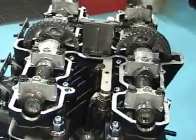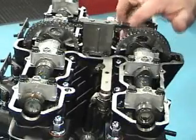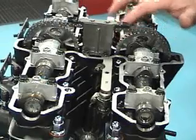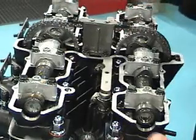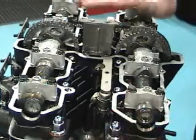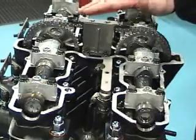Generally, when your head loosens up, it's usually on the exhaust side and it's usually back by your firewall. These back ones are the ones that see the most heat and will loosen up, so you'll probably get more pull on these than any of the others when you check your torque. It's good to check it every other race or every four or five races — they do loosen up from the heat, so make sure you check the torque on your head.